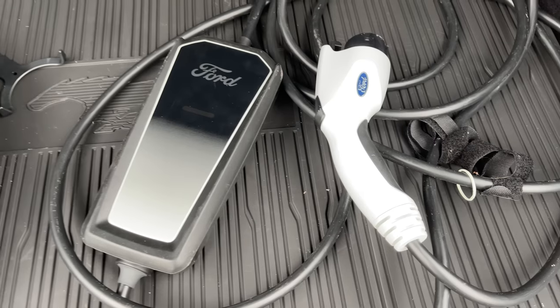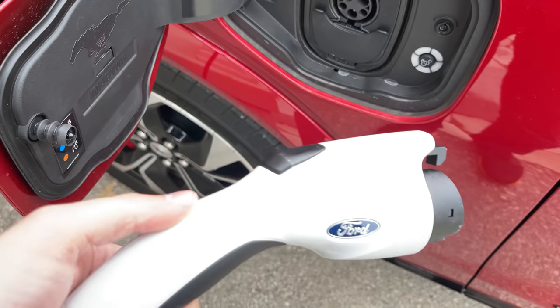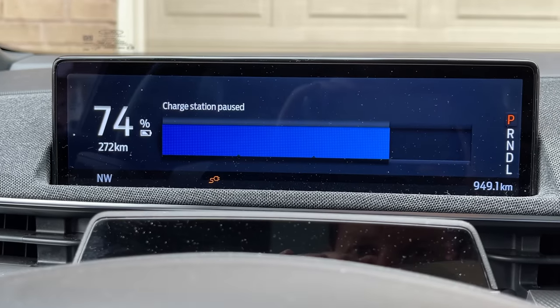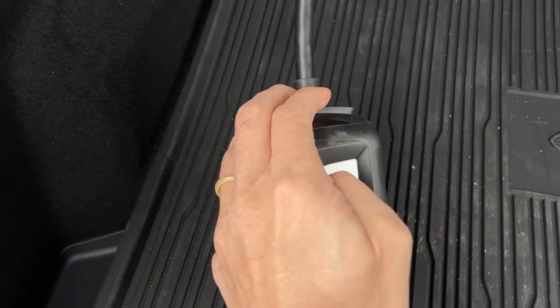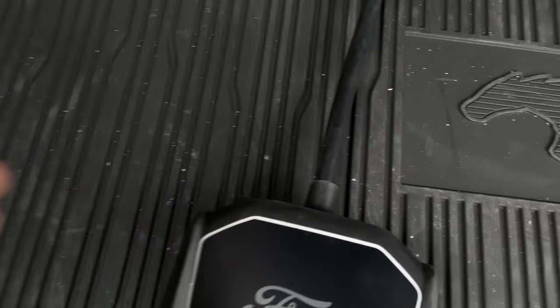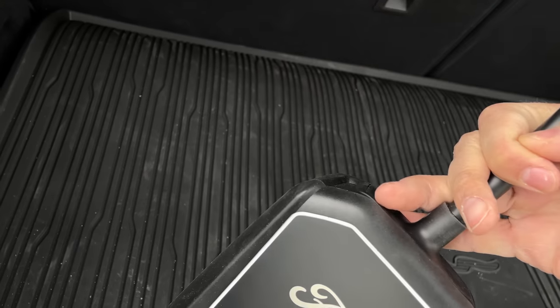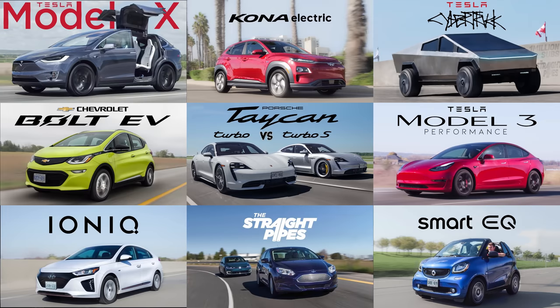You asked about home charging — I also had a problem with my home charger, which is the one supplied by Ford. It's a regular 120-volt charger so it's not going to charge very fast, but I couldn't actually get it to charge — it said 'charging was paused.' Ford called me after I posted on Instagram. The problem was that the plug wasn't fully seated in the charger itself, because there's a little portion of the plug that actually disconnects. It looks fully plugged in and you can tug it and it stays — you just have to push even more, with a lot of force. It's a plug design issue, not a breaker issue. I solved it by shoving it in more and it worked flawlessly.